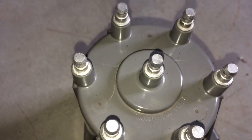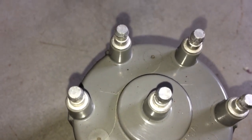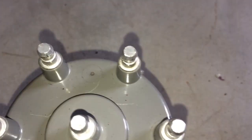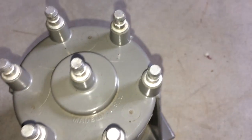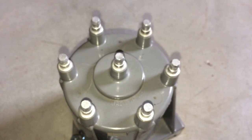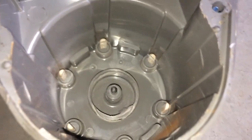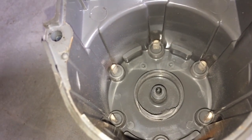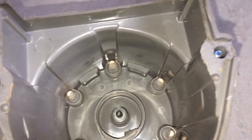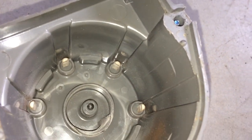As shown before, you can see better now that we've removed it from the vehicle — you can see the cracks. Crack right there, one going that way, one this way. This thing is definitely in need of being replaced. And looking on the inside, you can see the corrosion on the inside of the pins. Just to show you a contrast, I'm going to show you the new distributor cap so you can see how it should look.